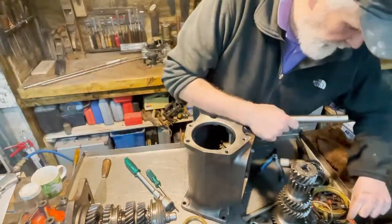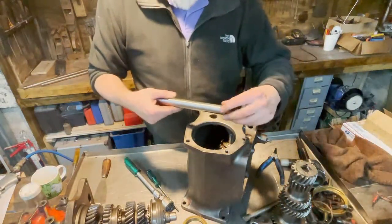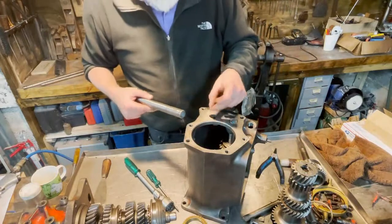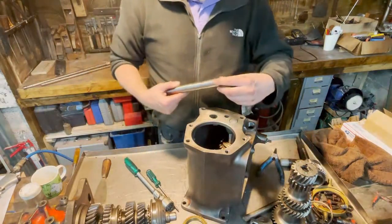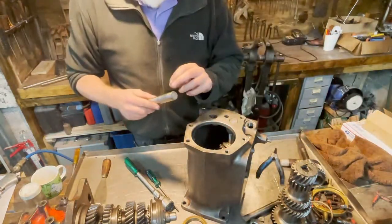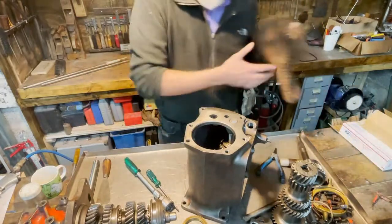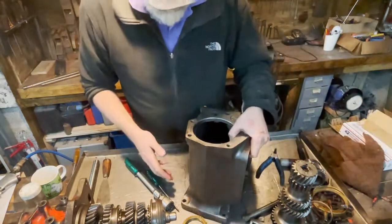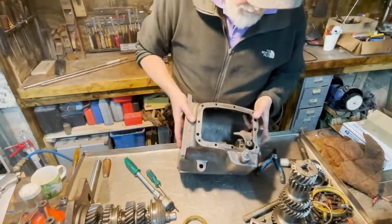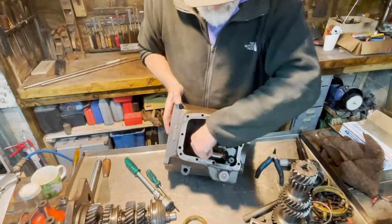And the reason for that is that it has those small wedges here. You can see the hole here is a little bit larger in this part, and that's where the wedge is. If you try to force this axle the other way, you will manage, but you will destroy the wedge and perhaps also the axle. I've seen it happen on YouTube. So this is maybe a little bit of a critical part, how to get this axle out. It needs to go out that way.